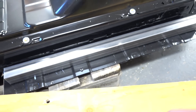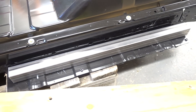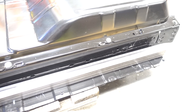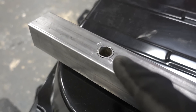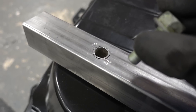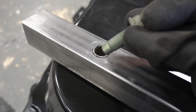We have this 40 millimeter square steel that we're gonna be using. But now we need to drill some holes in this, and of course this square tubing is reinforced with these inserts so that the bolt doesn't just squish the metal out of form. The bolt goes in here — longer one.